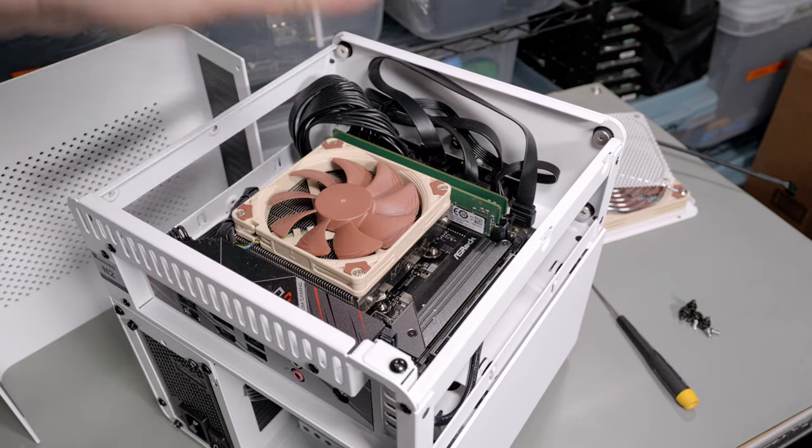It's been a week since filming the first part of this video — you can thank Newegg for sending me an open-box motherboard that had dead SATA ports on it. One was completely dead and the other would throw up a million errors and disconnect itself when trying to format a drive in TrueNAS. Got a replacement and now it works. I also put in a nice six-way SATA cable bundle to keep things more organized, though I had to cut part of it to give enough slack for the M.2 SATA connector. One thing to note: this board has horizontal SATA ports, so you need little 90-degree adapters — about $9–$10 — to use it in this case.